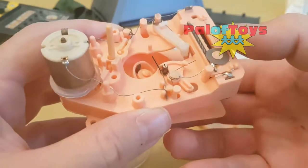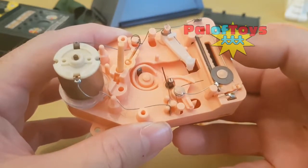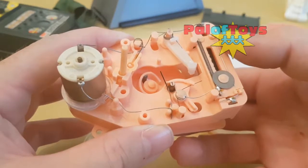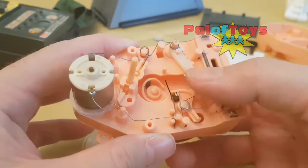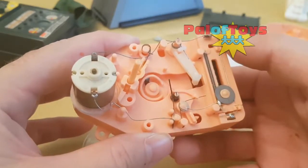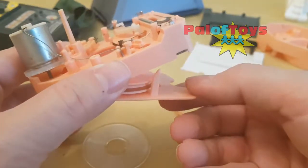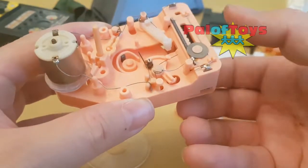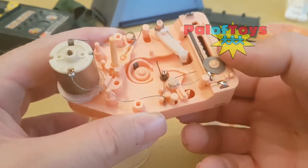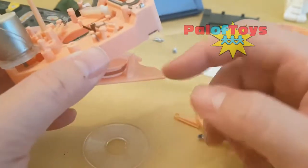If I open this — there you go, it shuts the motor off. That's what that arm is for. If I press it up you can see: as soon as that opens it kills the circuit. That little hammer piece — can you see — it's all done by that bit of plastic at the bottom. When it closes it goes up through that hole and completes the circuit. So if that peg is not present the circuit's never complete.